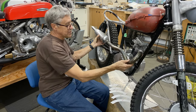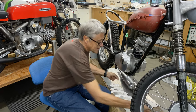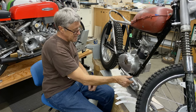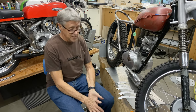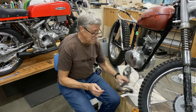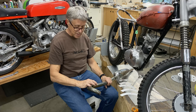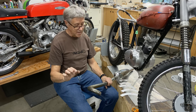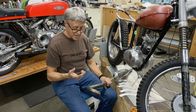Mitch is going to show you a photo of another Cub — it's got a low pipe. The pipe comes down with small radius, smaller radius, larger radius here. I need to order some tubing and I'm going to use inch and a quarter. I measured this — it's 1.3, or inch and 5/16. So I'm going down a little bit in size to make the exhaust flow a little faster. I think that's better.